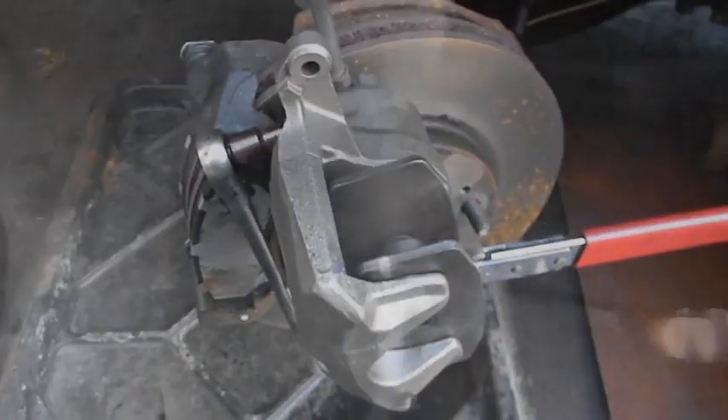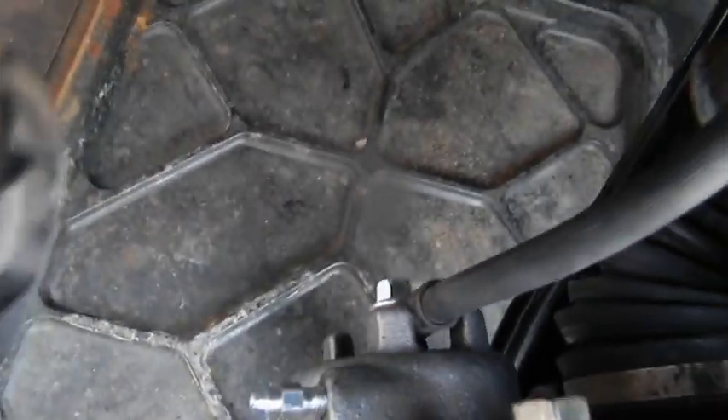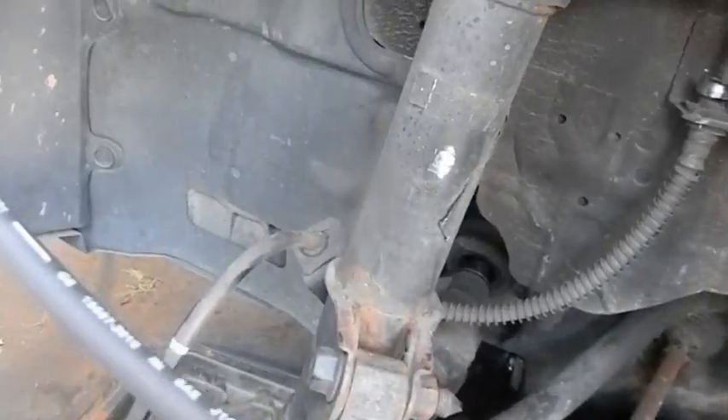Let's take this hose off and get to work. You've got a slide clip — looks just like this — and a flange nut. The bracket on the car holds the metal line; it springs around and does the same thing through here. There's a slot on the bottom for it to come out, and here it's got a banjo fitting.